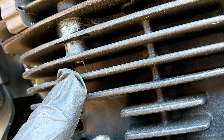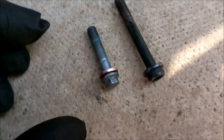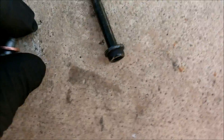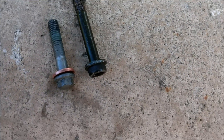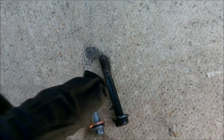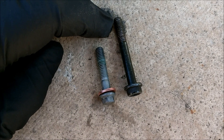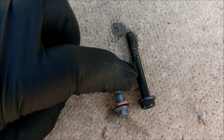Never work with kids or animals — or nuts and bolts! I have found a bolt here which is 15mm longer. It's a Honda bolt, so this bike is going to be more Honda than Royal Enfield at the end. Anyway, I'm going to lop off six or seven mil off the end and carry on threading down there with the tap and die set.